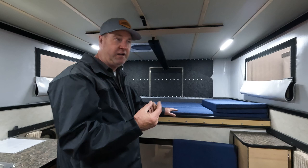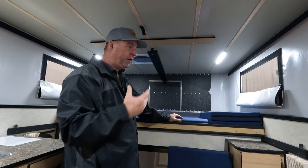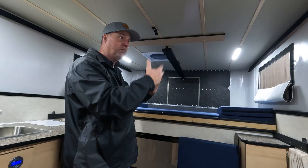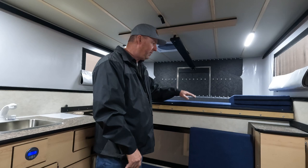For general interior maintenance: if you've been in moist areas with condensation, humidity, or rain, or had family in the camper, wipe down all the walls. Pop the roof up if you're getting ready to put it in storage for months. Turn the furnace on, turn the fan on, wipe everything down — just do a good air-out, clean-up, and wipe-down. Make sure your batteries and water system are taken care of, and the fridge is clean.